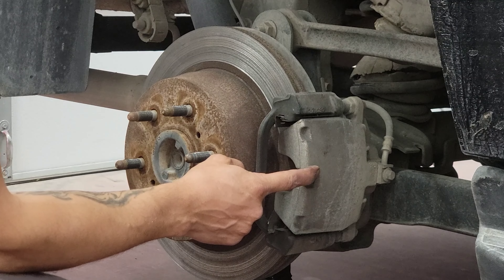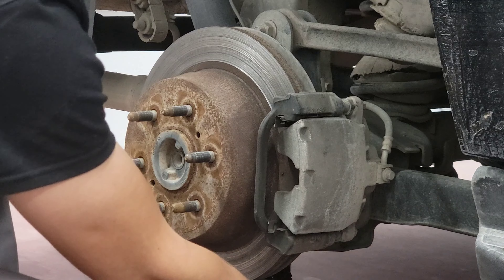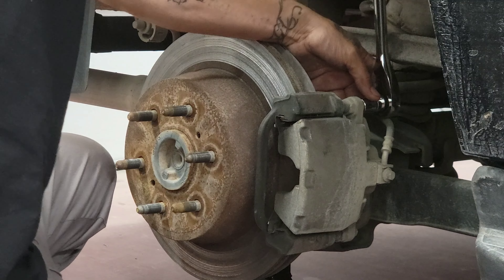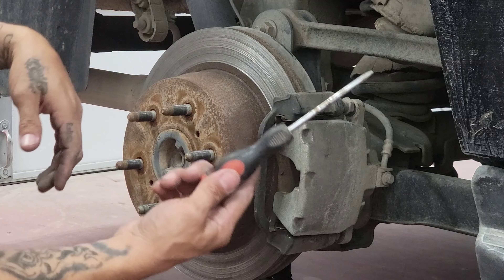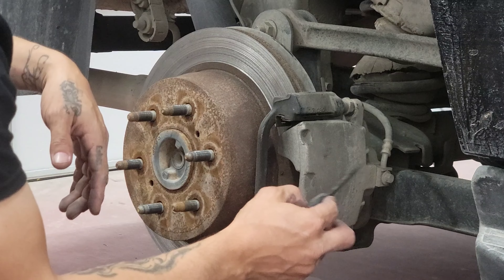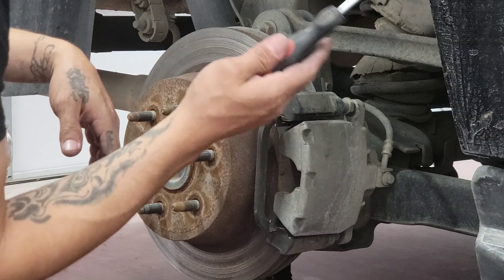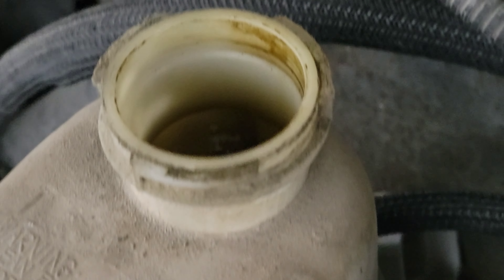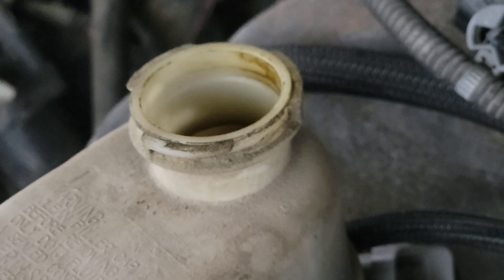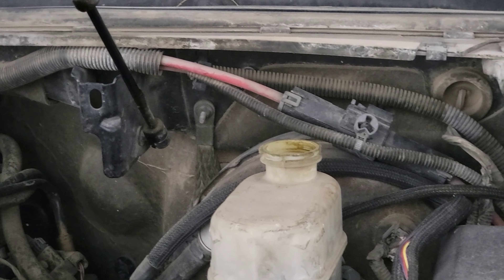Alright, I'll set up the tripod and we'll begin with the rear tire. We're gonna remove the caliper first — to remove it, it has two 13mm bolts. We're not gonna remove the brake line because that means we'd have to bleed the whole system again. I have a screwdriver and I'm going to retract the piston back into the caliper. When you do that it pushes the brake fluid back into the reservoir, so you need to make sure there's extra space in the reservoir and open up the cap so the fluid can come up without spilling over.